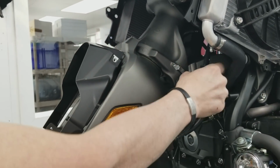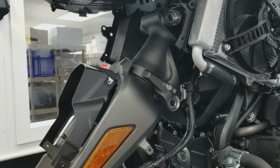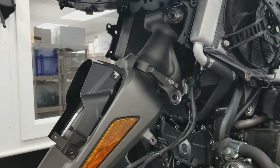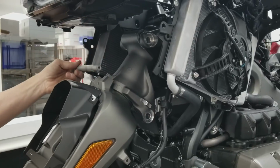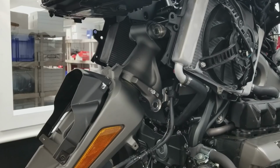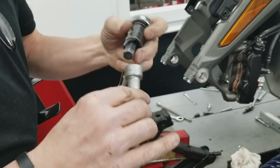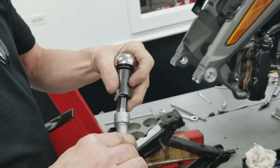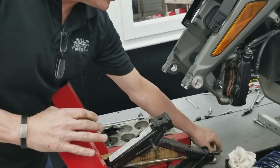There's a little bolt here you'll need to take away, because as I'll show you, we lift this whole operation away to get the shock out. We take the two big bolts out that are in the fronts of the control arms. Two great big bolts here. The lower one will require a 14 millimeter Allen socket. You're not likely to have this tool, but you'll need to have one in advance. So, a 1/2 inch drive, 14 millimeter socket. That's for the lower control arm bolt. That one's going to come out.